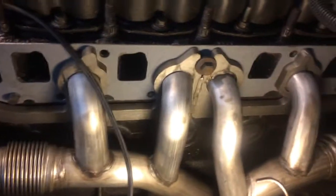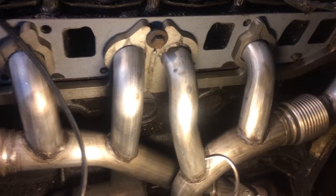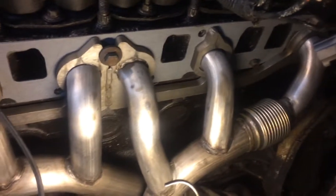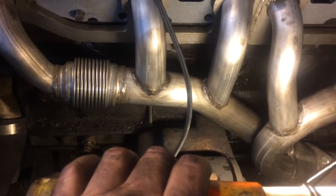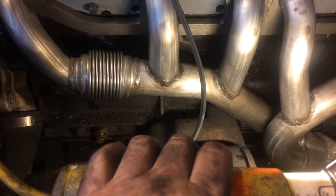I'm getting ready to set on the intake manifold. I've cleaned the surface up real nice, cleaned out where the injectors go in — everything looks nice on the mating surfaces. The eight bolts that go into that will be torqued to 24 foot-pounds in a specific torque sequence.